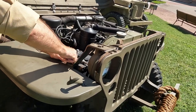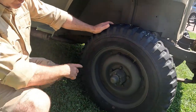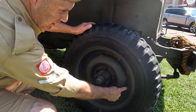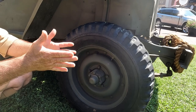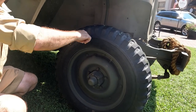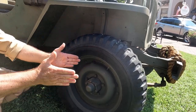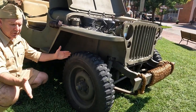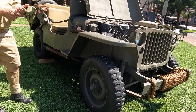Another feature is what are known as combat rims. Obviously you notice the lug bolts, but these bolts here — this is essentially a two-piece construction, not a split rim but similar. So instead of having to use a tire iron to get the tire off, you take them apart. There's a large rubber band that goes in between to keep it from pinching. You put your tube back in, slap on a new tire, sandwich them back together, bolt up, and you're ready to go.